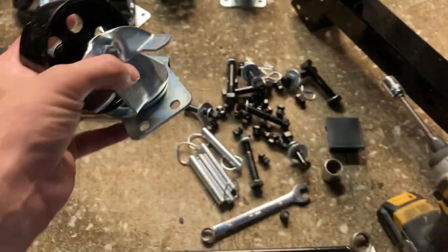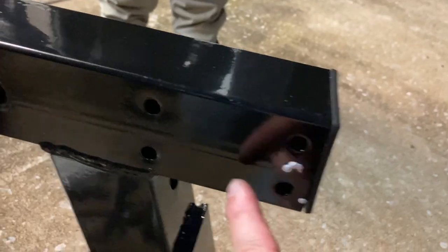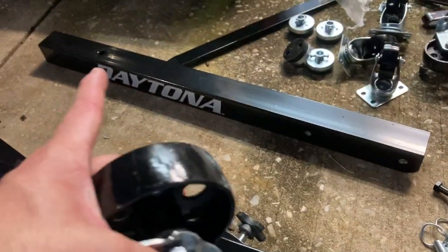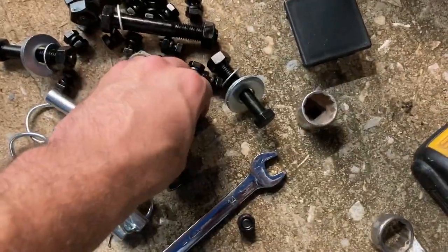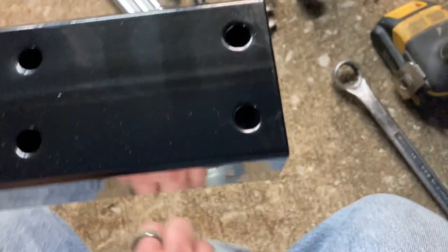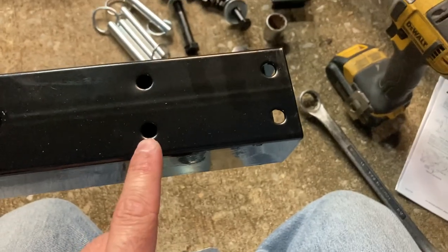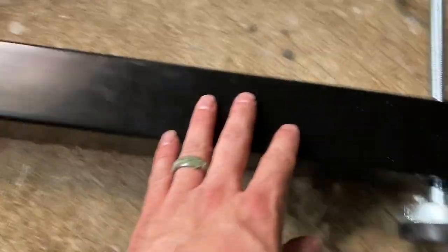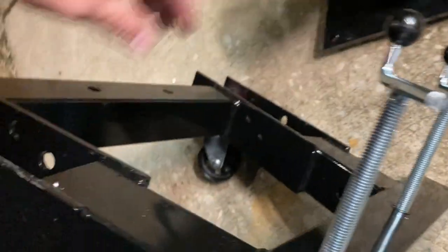The block comes straight from the machine shop onto the stand. It comes with six of these bolts — one goes on each side of this frame here, and one on each side of the two arms that fold down. You just take these little bolts and put them up through the bottom after you pull your cap off, sit it down, then put your lock washer and nut on. We'll torque them all down. We've got our wheels on there and our stoppers on the legs.